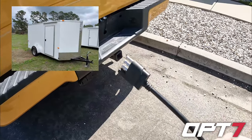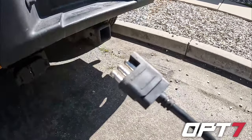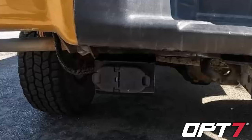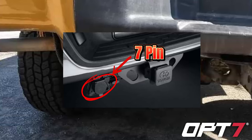When you get a box trailer, car carrier, or tow dolly, they usually have 4-pin connections for their lights. People call it flat 4 or 4-flat. This truck I'm using to demo with comes with 4-pin and 7-pin connections. However, some types of vehicle only come with 7-pin connections.